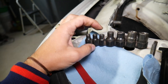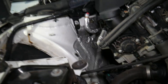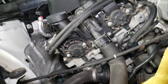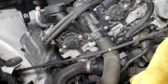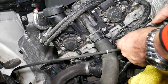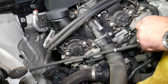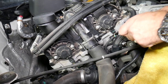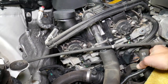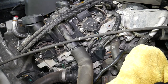The tool you'll need to remove the sensor is a reverse Torx 8, I believe. We'll demonstrate on one sensor, but the procedure to remove and replace both is exactly the same. We'll also have a special video on the channel explaining how to test the camshaft position sensor. You'll also need an extension so you can get down lower — otherwise it will not work out.